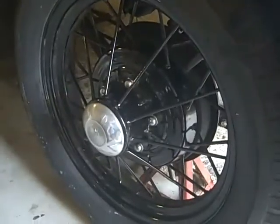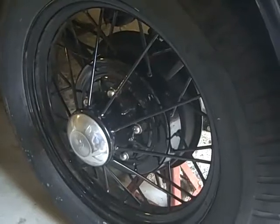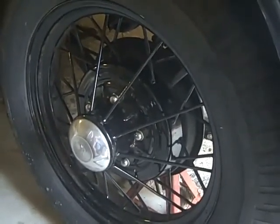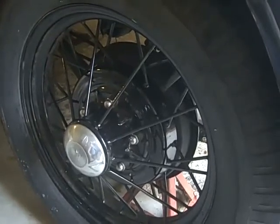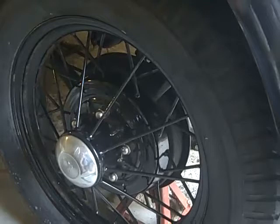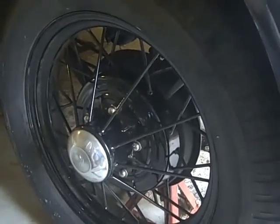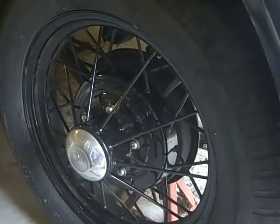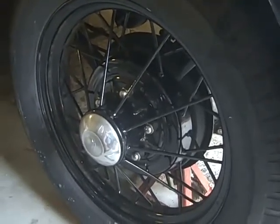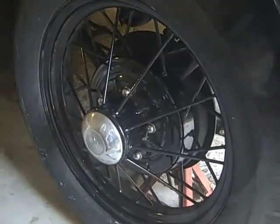The wheel has to come off, then the drum has to come off. The brakes have to be relaxed in their adjustment — I usually just relax it maybe 10 clicks, so when I'm through I can just put it back 10 clicks and I don't have to worry about adjusting the brakes. You might need a wheel puller to pull off the hub, and then you just simply put a shim on around the axle on that tapered part and put it back together.